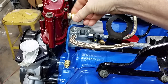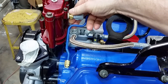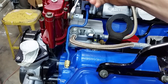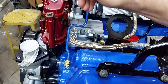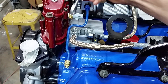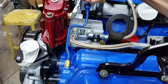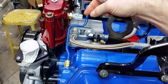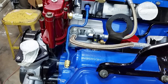First is the oil temperature sensor — it goes right here. They have sealer already on them, so there's no need to put anything on them, just screw them in. It's a 19mm wrench. This is screwing into aluminum, so you don't want to be reefing on it like He-Man. Let's try that because that puts the clip up. I don't know if we can make a whole other turn — let's leave it there.